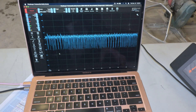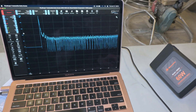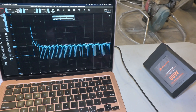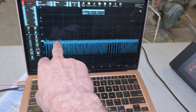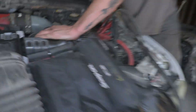I'll take you over to look at the scan tool — I did a relative compression test on her to make sure we had compression in each cylinder. I cranked this over for about 10 seconds and it all looks pretty decent — pretty uniform. A couple were a little bit high but I don't see anything there that's a huge concern for me. Jacob is getting some access to the injectors. I'm pretty sure it's injectors at this point.